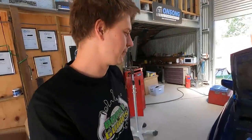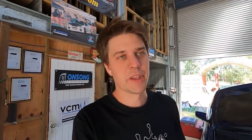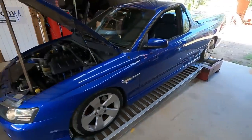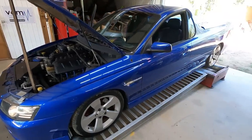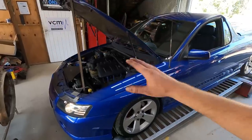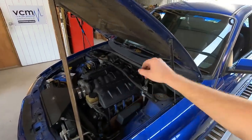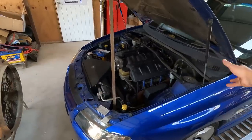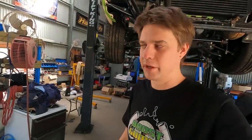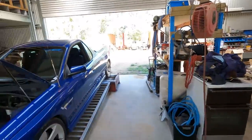I'm excited to be putting this cam in a few more cars. The next one is a Monaro, which we're doing pretty much the exact same combo as my WK — I'm going to get some 799s for that, so there'll be a few interesting comparisons. We'll get our pre-runs on this VZ, see what we're dealing with. We're not changing the exhaust or anything — that OTR and exhaust are all staying the same. It's just cam kit, CNC ported heads, new converter, trans cooler, and the rest of what comes with one of our cam kits from OSP Warehouse.